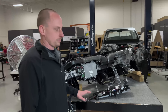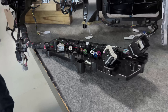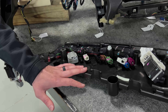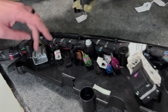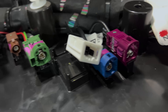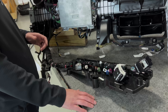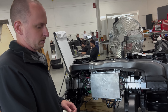We'll start with the IP, the instrument panel first. I do want to give Rivian credit — they've done the impossible — but there are a number of areas that need to be looked at more closely. First and foremost, this panel here sits on the hinge pillars of the body. This is actually a neat execution. We've seen Land Rover do this before, where all their connectors are snapped into pre-fitted areas. You might think this is a cost and weight hit, and it is to an extent, but what this allows them to do is keep these connectors always in the same location and orientation every time. So when the instrument panel is installed and they need to marry the body harness to it, it's very consistent and easy to get to — an operator isn't having to fumble with two separate loose connectors. This is a pretty clean execution, a little heavier than we're used to seeing, but headed in the right direction.